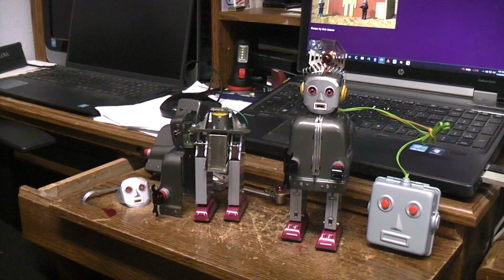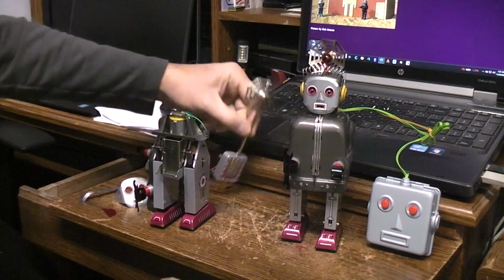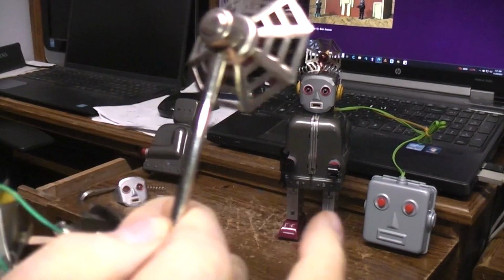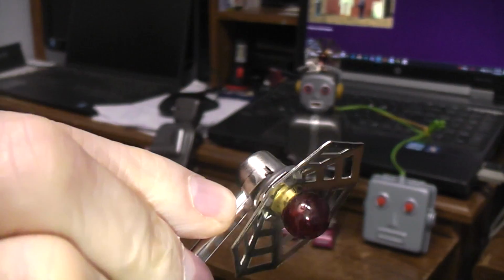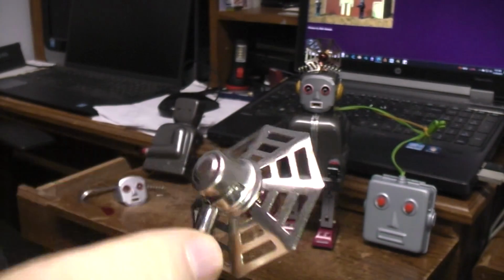And they all had some problems. I'm going to go over some of the most common problems. Of all the ones that I saw back in the day, and that was over 20 years ago now, the ones that worked would usually have a damaged antenna. The joint between this and this part of the antenna, as you can see, just that thin little metal piece there, well, it would either break at the top here, or was always coming undone there.